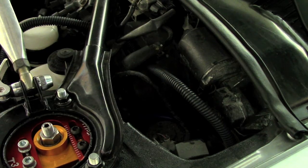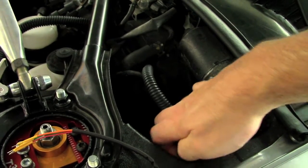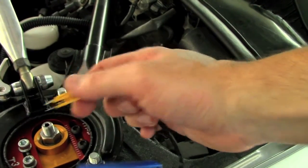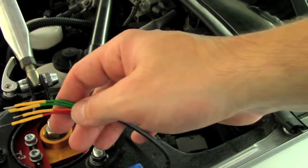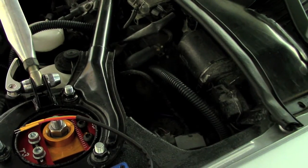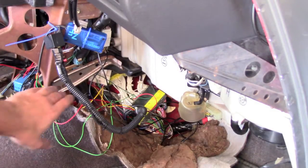There are a couple of ways you can do this. It has these pins designed to go into the diagnostics ports, which is one option. However, the problem is these pins are designed to fit fairly tight, but if you have any movement while driving and a pin gets pulled causing an arc, that could cause electrical problems. To avoid all that, I'm going to directly wire it in — wire it into a patch harness I have on the ECU.